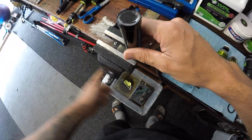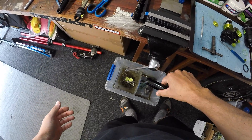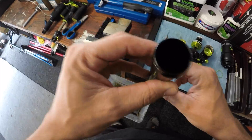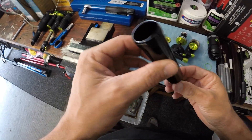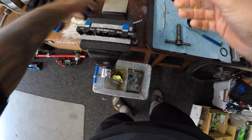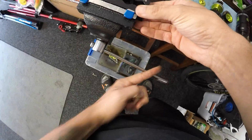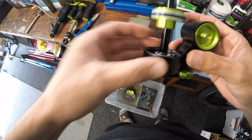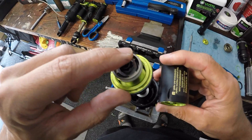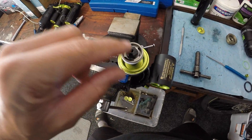As you can see, the damper body is full of oil. As we're going to use different oil when we rebuild it, we'll get rid of that. If it was all filthy you'd want to clean it out and ensure everything is spotless. For this part you will need a set of vice clamps, and what we're going to do is clamp onto the damper shaft itself, because we need to undo the compression rebound piston in order to remove the seal head from the shock.